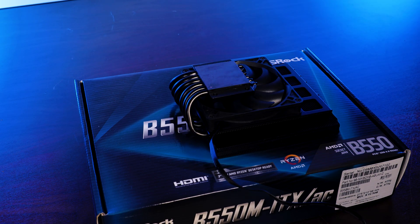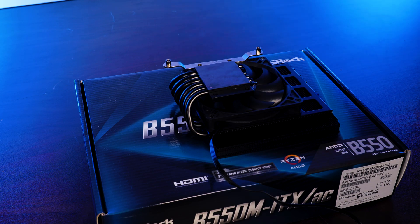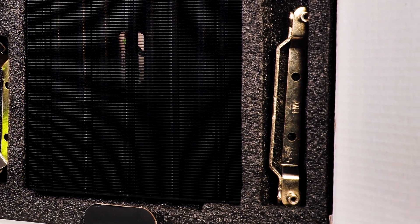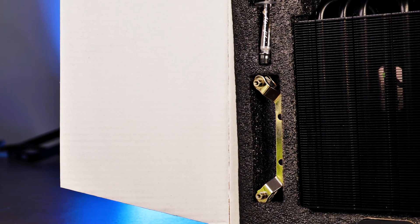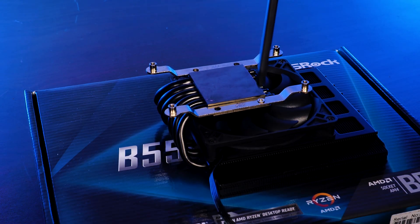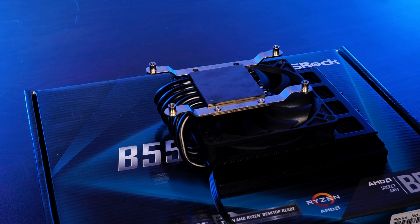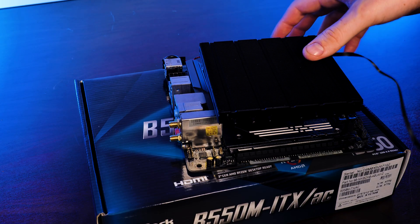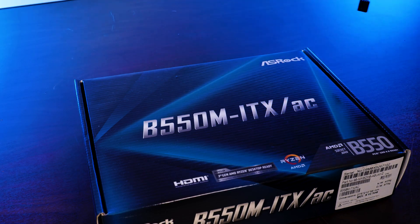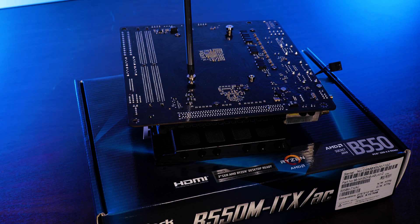Let's go over the installation. The installation procedures for both AMD and Intel are surprisingly similar. We need to rotate the cooler and install the brackets onto the base — the ones engraved with AMD for AMD and the other ones for Intel. Both brackets need to be installed in an outwards-pointing orientation with the ends pointing away from the base, and screwed in using the tiny screws that were so neatly packaged. From there, on both platforms, position the cooler with the heat pipes coming out at the top of the motherboard and screw it down from behind using the bigger screws.